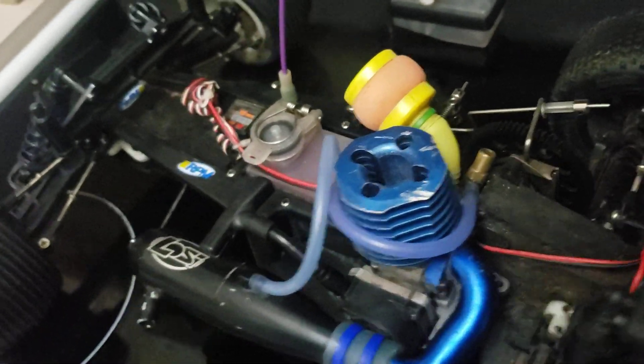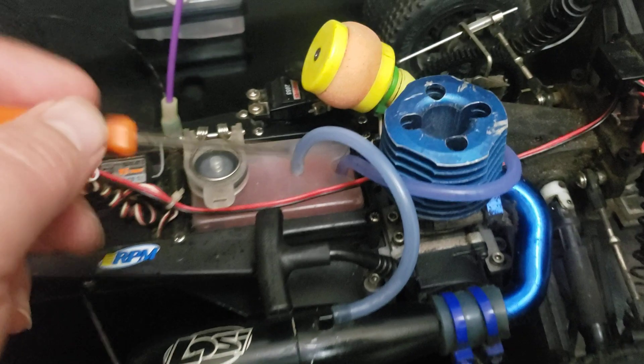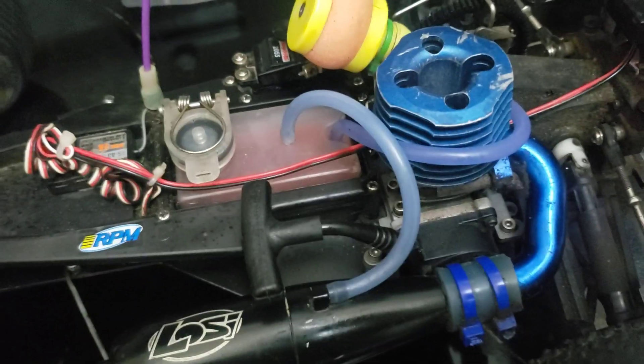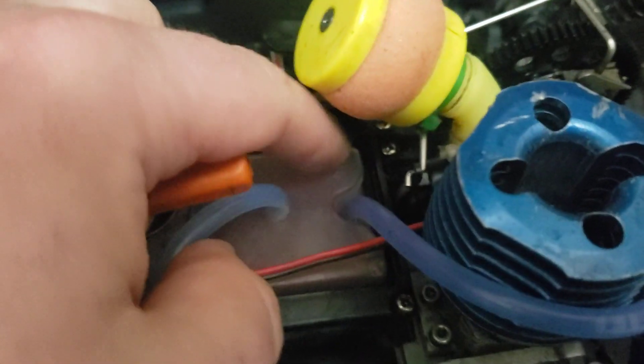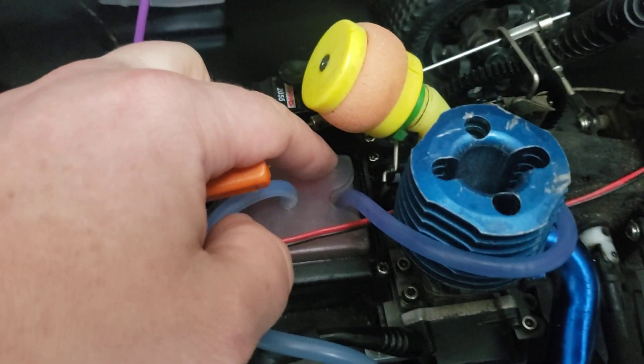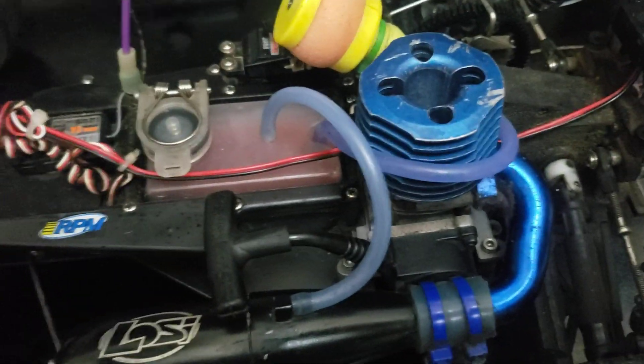I've seen a couple of comments from you guys about that. Also, if you have one of those primer buttons — like on the SMT-15 that three sons garage is having a hard time with — those are notorious for leaking, which again causes tank leaks and tuning problems. Pull that thing out and just JB weld it up, or plastic weld it if you have that, or just buy a new tank.